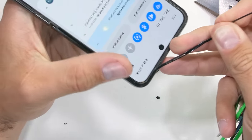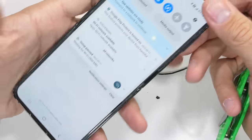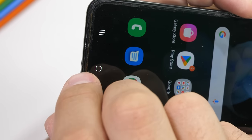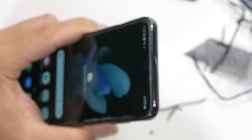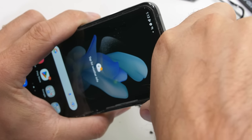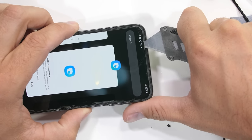I'm going to try and disassemble and reassemble this Flip 4 in one piece, something I have yet to accomplish with any other folding phone. Starting with the plastic bumpers, we can get those out of the way. I notice that the screen's ribbon cables are folded around the bottom edge of the display, which means that if we start lifting from the other side — the top — and make sure not to flex the screen in more than one direction at a time, we might be able to get it off successfully.